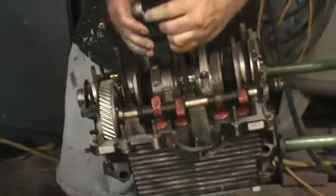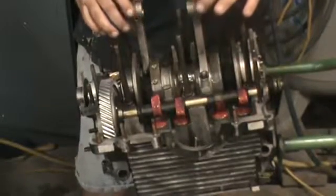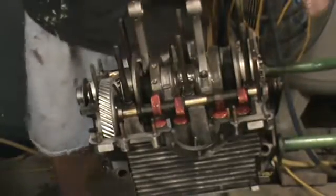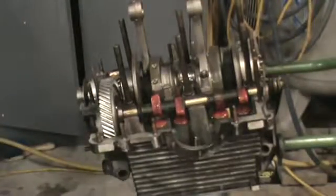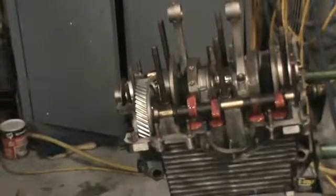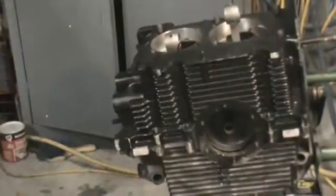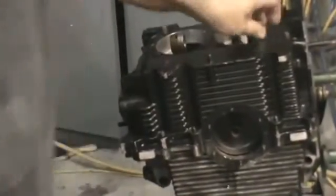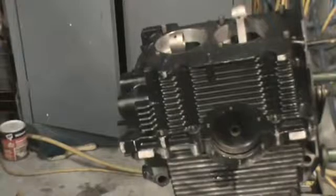We're gonna put pressure on our rods again, make them stand up, hopefully. Gonna give it one more look. We got our cam plug in, we have our silicone in place. I think we're good to go. Let's lower the case half to get this bolted together. We have our bearing in here, we have our lifters, we got our double thrust bearing. I think we're good. There we go, guys. Lift your clips out. Get some silicone and bolt our six main studs down next.